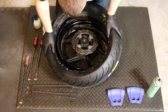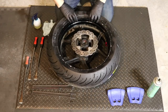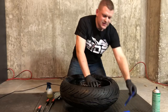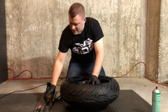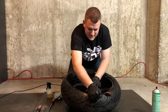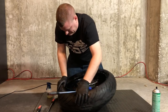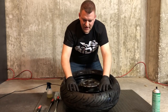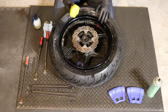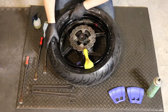If you're lucky, you can push the first side down. That's the first side down. Now for the other side, you're not going to be able to push it down, so we need to use the tire irons again. We take our Motion Pro bead protectors, slide that in, get our tire iron in, and go ahead and push that lip down once we've got it started. One thing you'll find as you're working this around is it's going to continue to want to pop up, so we're going to go ahead and use the yellow thing. We clip that down, and what this is going to do is hold that bead down as we work around the tire.